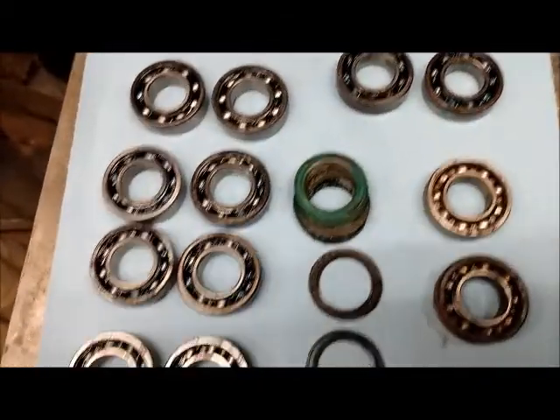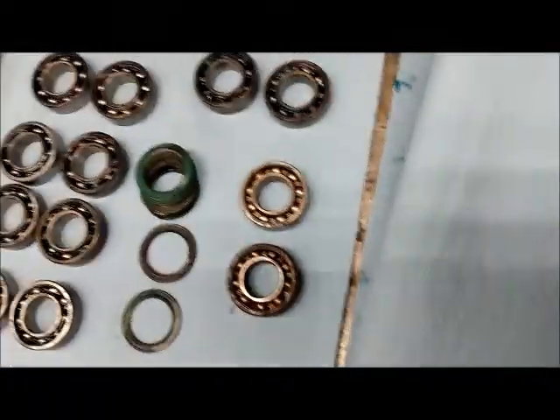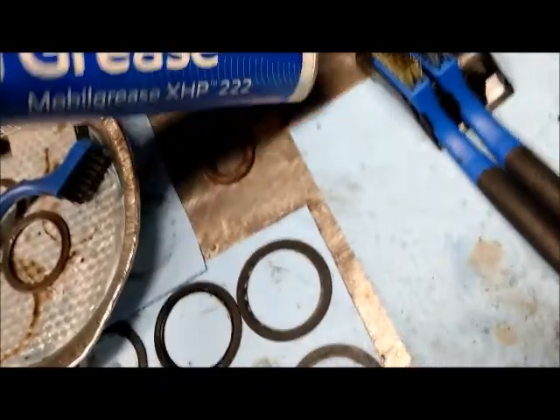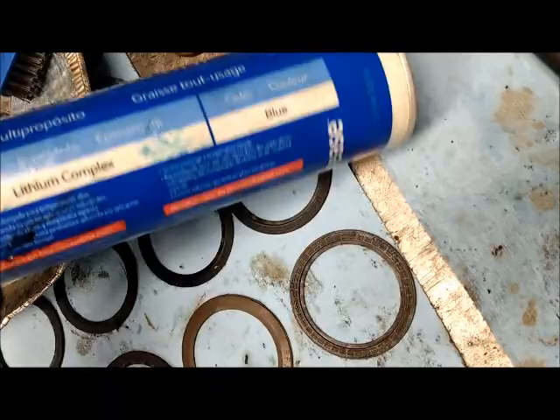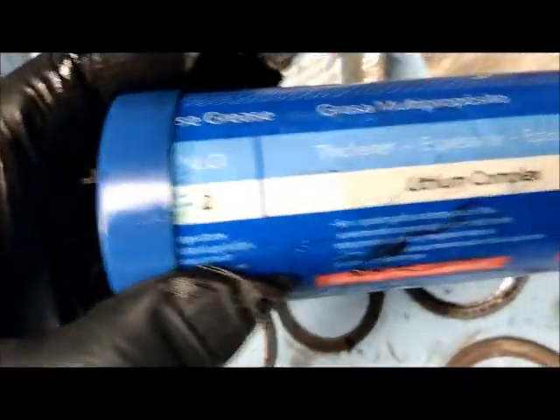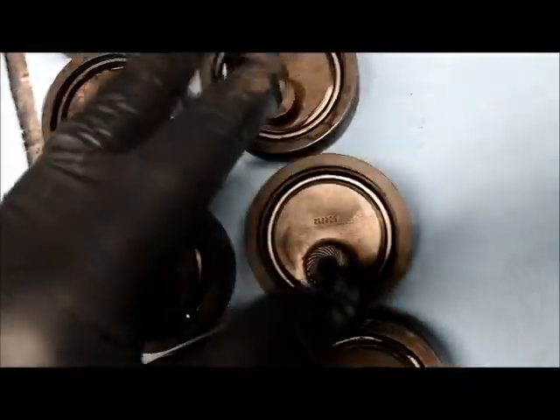With the bearings for the torque tube drive shaft, I had a couple here that are no good — they're rusted and seizing up, so they're going to be tossed. For grease, I'm using Mobil XHP 222. What I like about this is it's a lithium grease, number two, and it's a very sticky grease that will take some temperature, because these bearings are going to see some speed, especially the drive shaft one.